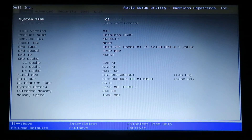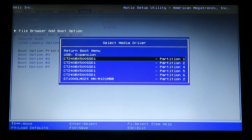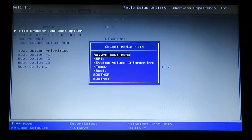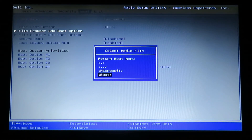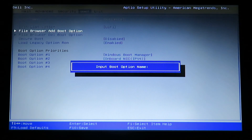Now you are in the boot settings. Go to the boot tab — here you can see all the various boot options that are available. However, SSD is not there right now. To add SSD as an option, go to 'File Browser Add Boot Option'. In my case, partition 2 is where the boot partition is and that is where the EFI file is present. The EFI file has instructions about where to boot from. Click on partition 2 and here you will find a folder called EFI. Click on it and go to the boot folder inside this EFI folder. Here you will find the bootx64.efi file — this is the EFI file required for the boot up. Click on it, and you will get an option to set a name for this boot option — I went with 'SSD'.